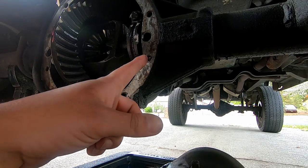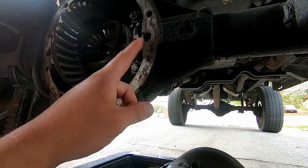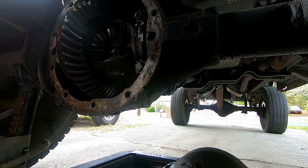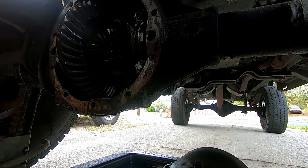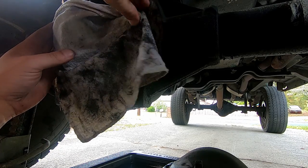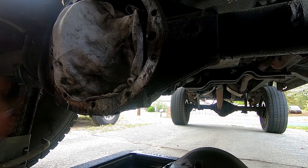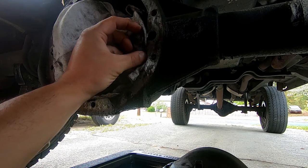Now for the real fun part - I've got to get this bolt extracted out of this housing, or what's left of that bolt. I've been a mechanic for many many years and getting a broken bolt out always sucks, every time. Before you start drilling around an open differential, I'm going to cover it up to try to minimize the amount of drill shavings that get in there. If anything jumps on that rag, when you pull the rag off it'll fall down, and it'll keep metal shavings out of your gear set - because metal shavings floating around are not cool for a differential.